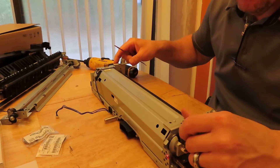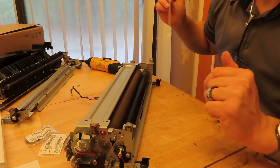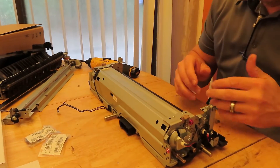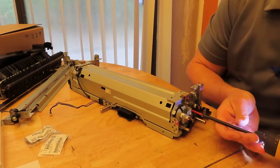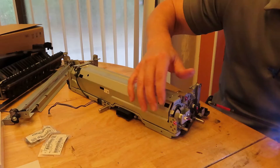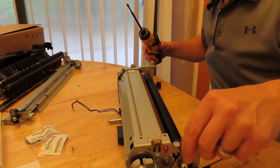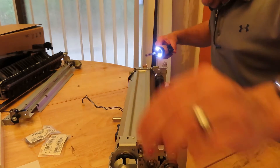Set it to the side. You have your lower heat roller right here and your actual fusing belt is this darker color right there. Now we're going to go ahead and separate the bulb holders from the unit so we can disassemble and pull out the bulbs. They can be somewhat snug in there, just go ahead and kind of loosen them up. It's the exact same thing on the other end — the holders on that other end right here, just two screws.